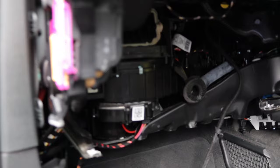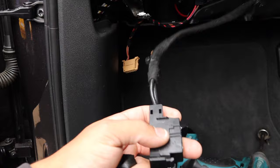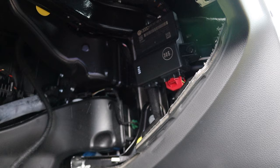Once all that is removed, put the screws somewhere safe. There'll be a couple of plugs - one on the bottom of the glove box, and there might be an AMI plug that runs into the glove box. If you're purchasing and it says 'with AMI,' that's the plug on the inside of the glove box. One thing we need here is the CAN junction.